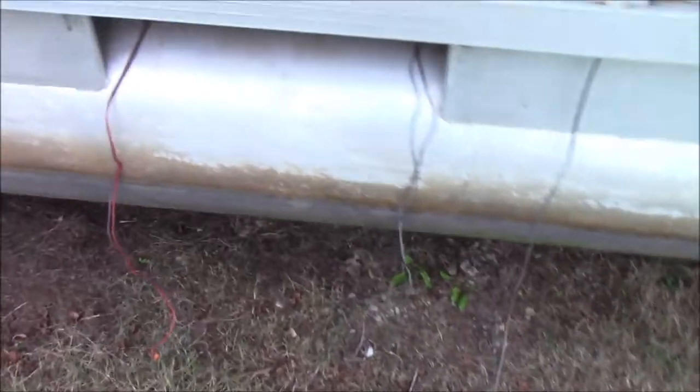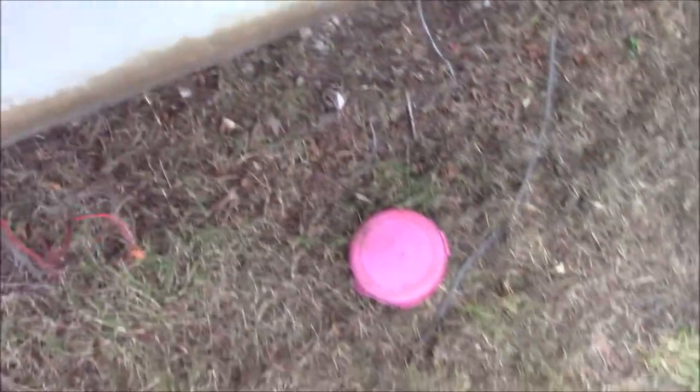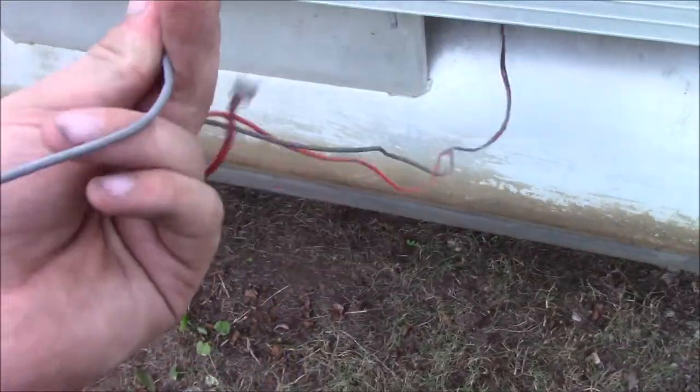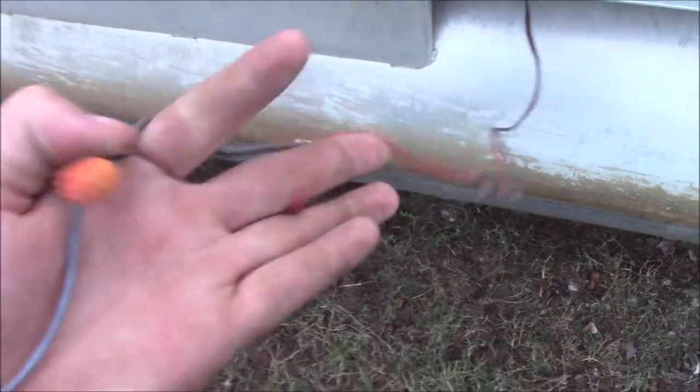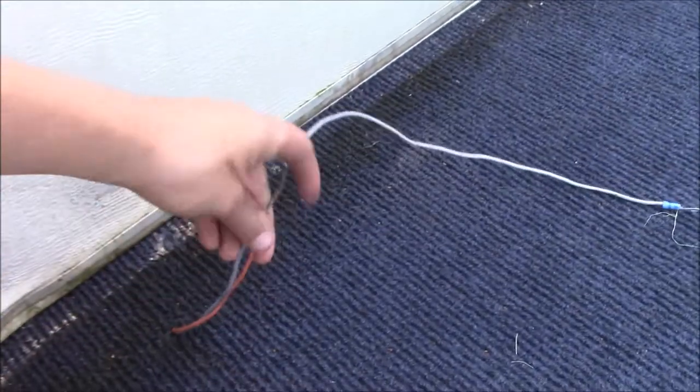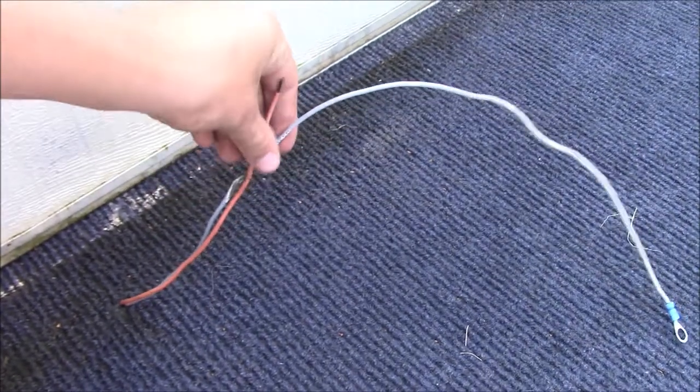Wiring update here. The only thing that's really wiring besides that cable, which is already fixed, we fixed in part three or four. It was just broken. But this was wiring that had been done inside of the console, apparently fixed before. We'll probably do something else there. These two wires run back here, come up out of the floor and connect directly to the battery. This is our 12 volt feed for our lights.